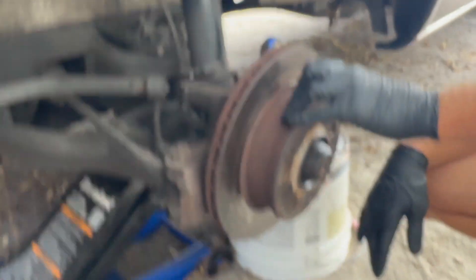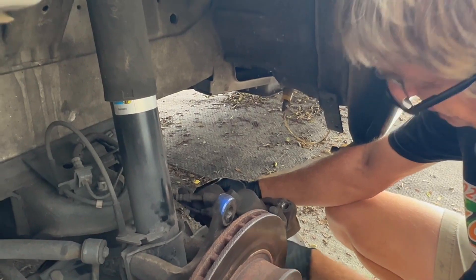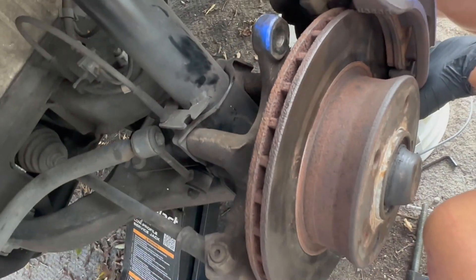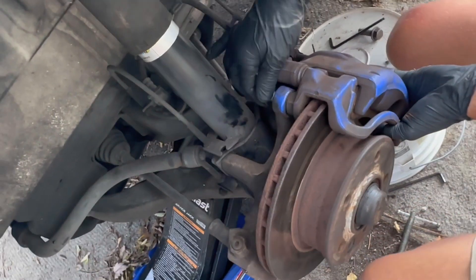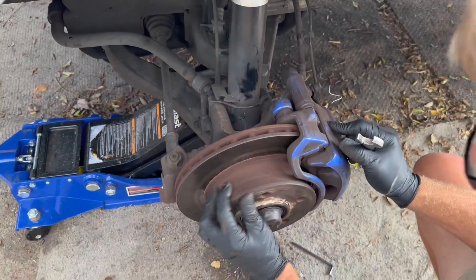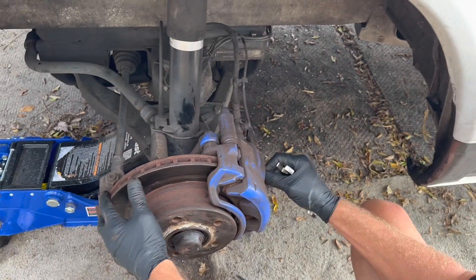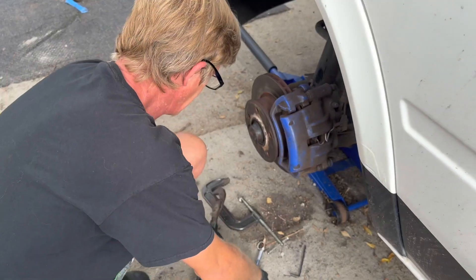There's no more growl in there. Looks like my brake wear sensor is not in the right location — that's not where that's supposed to be — might have to squeeze these open just a little bit to get that back on. All right, good deal. The caliper's nice and tight; make sure everything still spins nice and quiet. Put this in here where it's supposed to be — there it goes in there like so. You want to get around the other side and look at where that went. Then we're ready to put the wheel on.